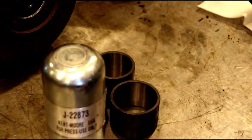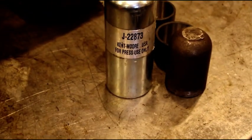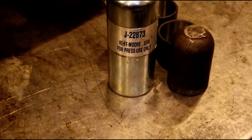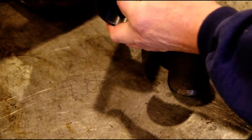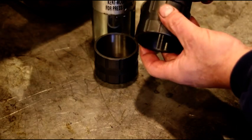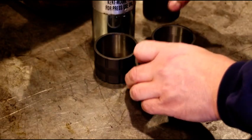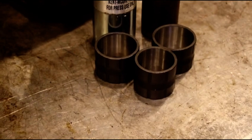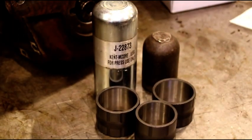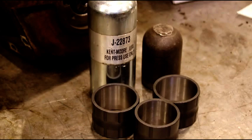In addition to the bushings, there are my 2 press tools. Now, these are specifically designed to press that bushing on. It fits it perfectly. Oh, this is the third gear one right here. Fits that perfectly. Put that in a press, that bushing down nice and square. You can make those, you could turn them on a lathe, you could put a cap on top so you got something to press on. I do recommend you pre-figure out how you're going to press those bushings on.